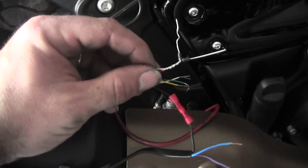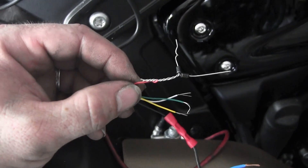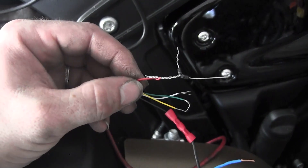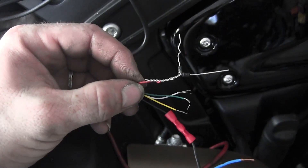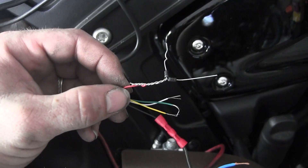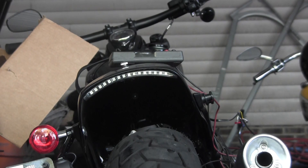The problem is how to get three wires to activate five wires essentially. My solution is a pair of diodes that hook to both turn signal power leads — that way, whichever one is applying brake power doesn't back-feed the turn signal and stop it from blinking, but it does power the brake light. The diodes prevent back-flow of electricity into the other circuit. I'll solder this up, get everything cleaned up, and we'll give it a test — maybe we'll have a smoke show.